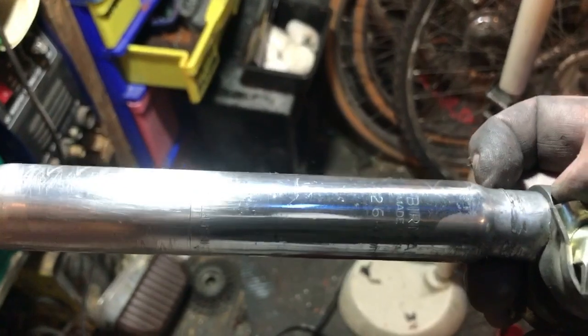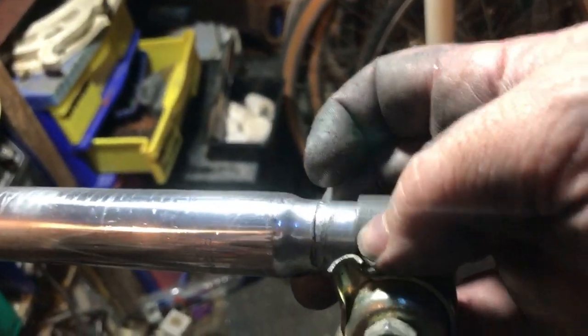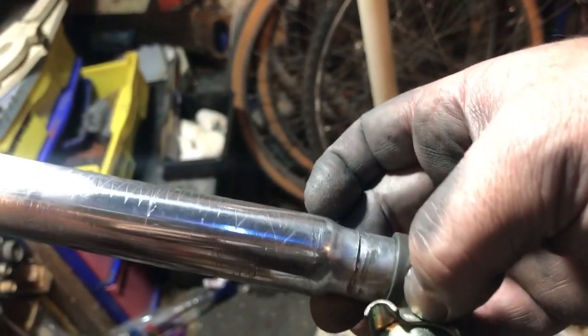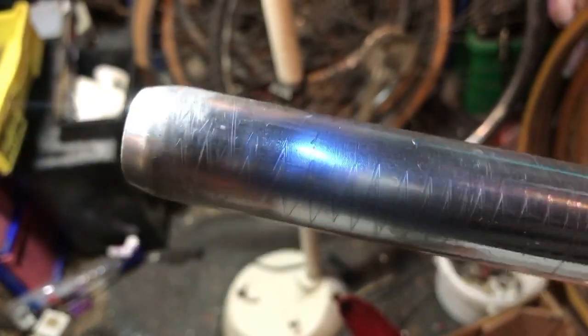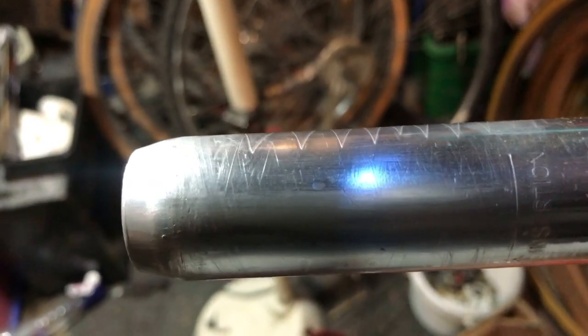As I said I was polishing this seat post, I'm sure at least one or two of the knowledgeable bike geeks would have said 'no.' Don't panic — I have only polished it down to where the maximum mark is, which is about where I'll be having it anyway. I've left the bottom half dull and gone over it with coarse wire wool to give it a bit of extra key. If you've got a very shiny seat post inside your seat tube it's not going to grip very well.